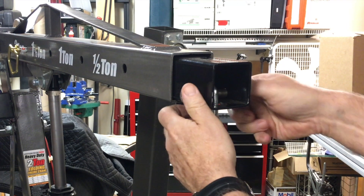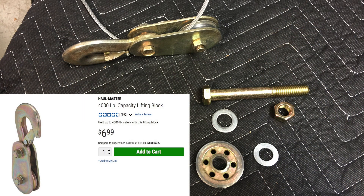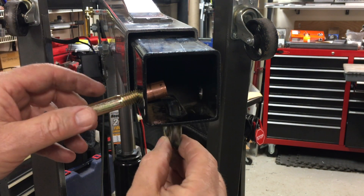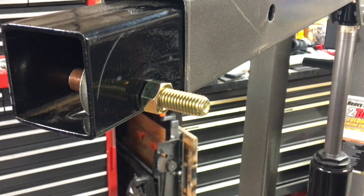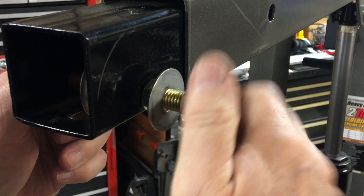The standard lifting chain was removed, which is just held by a bolt. I purchased two Harbor Freight 4,000 pound lifting eyes. One I will use to slow the travel of the winch cable and reduce the strain on the winch. The second was because I needed a pulley. The axle for this pulley is one half inch, so a four inch grade eight bolt from Tractor Supply was used. I cut two pieces of one half inch copper tubing 0.8 inches long to keep the pulley centered in the slot. I just used a large washer and a locking nut on the end to fit the hook better.